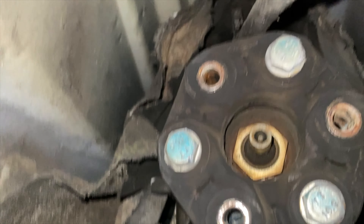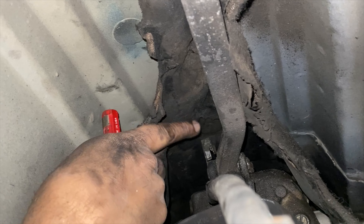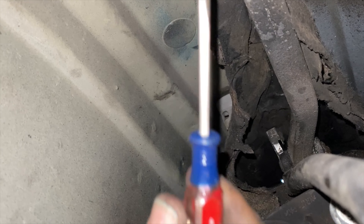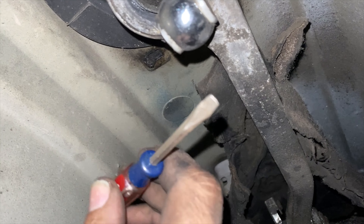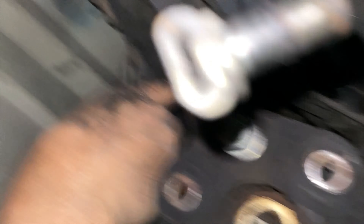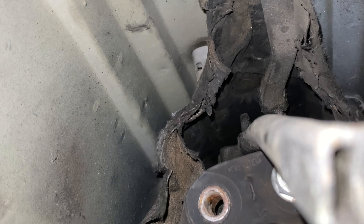The transmission really wasn't dropping at the angle I thought it would, and I realized it's braced right here — that's what's stopping it from lowering more. After some more YouTube searching, I found that this clip folds down and locks a pin in place. It's a real pain to get off. I used a tiny screwdriver, pried up underneath there and wiggled it free. The video said to use a small and a big screwdriver, but I got it done with just one. You pull this pin out and that should release it.